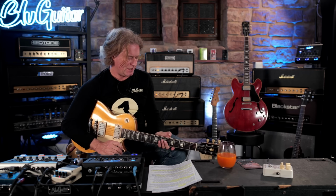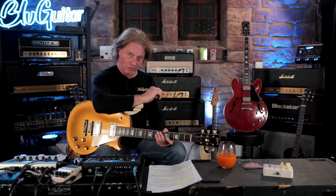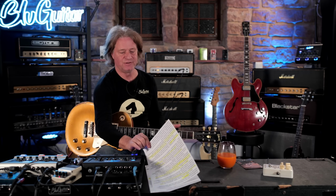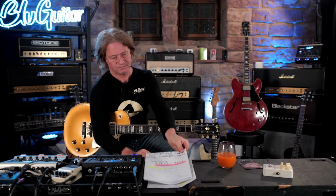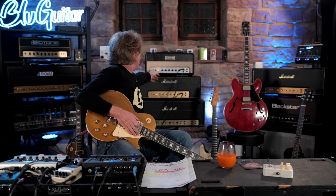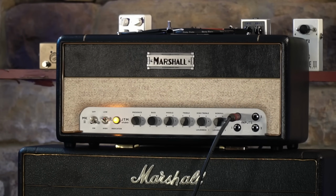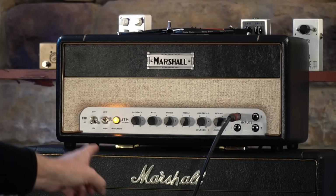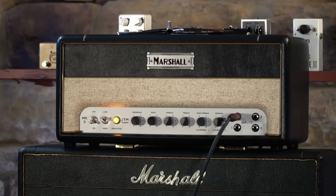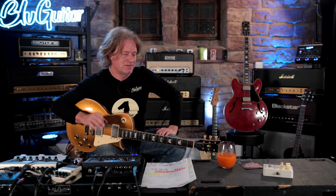For what it is, it's pretty okay concerning the weight. It's a head, it looks cool. It has all the features that you expect from the old amp. But it also has a few features that are new. So this amp has, besides all the traditional stuff on the front panel, a switch, the standby switch, which can be high power and low power. The 5881 tubes deliver 20 watts on this amp, but they can also switch to, I think it's 5 watts output power. So that makes it nicer in a way.